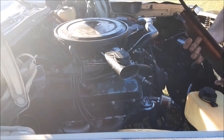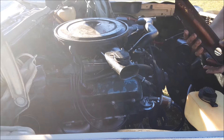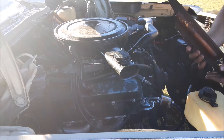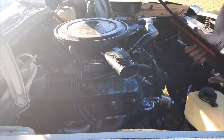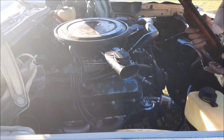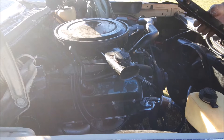Cheap imported junk — except for these two inverted flare hose barbs that I got for the transmission cooler. You can see the nastiness on the inside. I did flush the radiator and block because I had the engine sitting in my garage for over 10 years. For a while I was thinking I'll sell the 71, so I pulled the rebuild engine out and put the original engine back in. It had been in it for at least two years with the parts store cheapy radiator and I was driving it back and forth to cars and coffee — it was doing fine. Finally this side tank just decided to let loose. Buyer beware when you get cheapy imported parts, Battle.